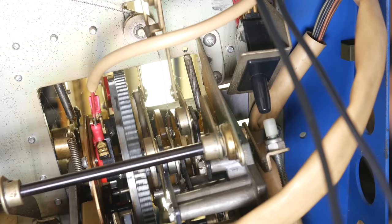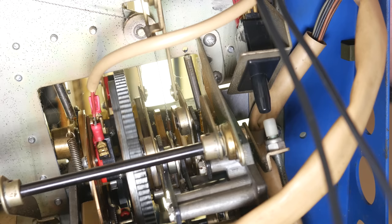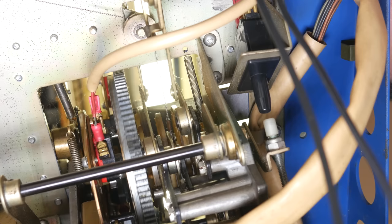But of course, the main cam motor doesn't just have power on continuously, or the jukebox would be useless. So, I told you that when the readout switches hit one of the pins, the side 1 or side 2 relay will redirect power from the carousel motor to this motor, the one we've just been looking at. Well, cool. But now what?